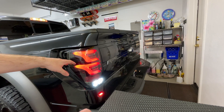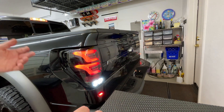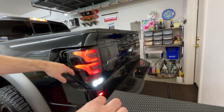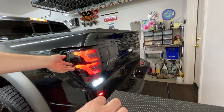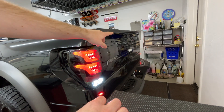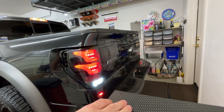If we go ahead and hit the brake, you'll see what it looks like when we light up the brakes — it lights up nice and instantaneously because it's LED, and it is quite bright from the back. If we let off the brakes, we can turn on the turn signal and you can see what that looks like. We won't do the turn signal on the brakes — I just tried that and it doesn't actually turn on the light that's signaling. On these trucks, because it's flashing the brake light essentially, it will only turn on the cab light — the third brake light — and the other brake light, but not the one that's signaling.